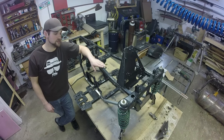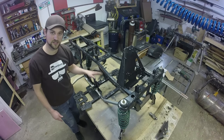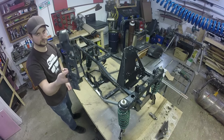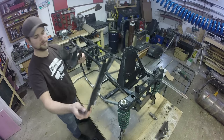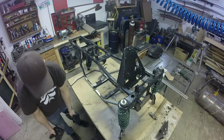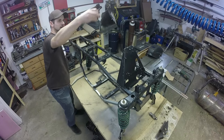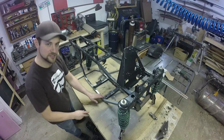I'm going to get back to work on the Screwdrive ATV. I've done a few things to get ahead of the game here - I've removed some of the excess weight. I've gone ahead and torched off the footrests. I've also taken out the original mounts that the swing arm went to - kind of big ugly things that were pretty flimsy. Got rid of the rear mounts that used to hold some of the rear fender work together, and the battery box. So that's lightened everything up quite a bit, and now this is all open.